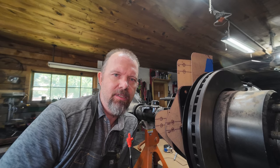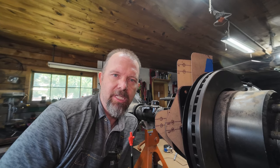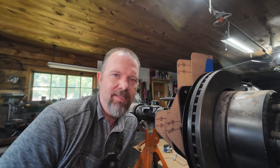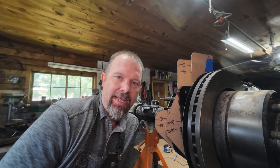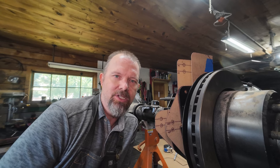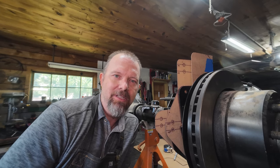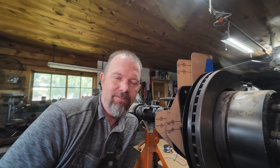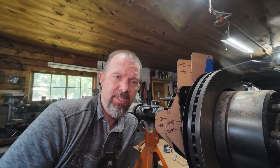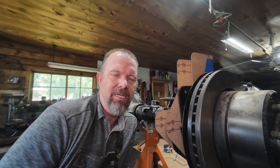I'm going to do one other big thing on the rear axle: I'm going to design this so that I move the rear axle back about an inch to an inch and a half. I think with a 40-inch tire on the JKU, if you're going to get it low, having the rear axle moved back slightly is going to be better for packaging. This would be optional in the concept — it's just something I'm doing.